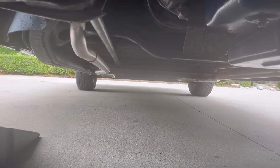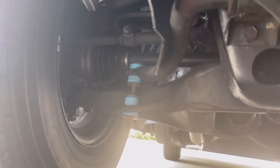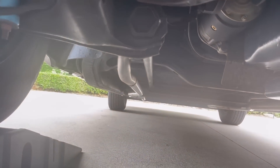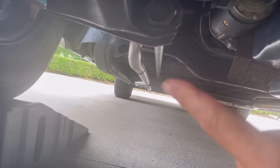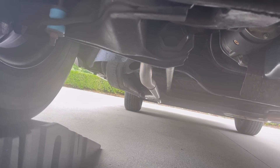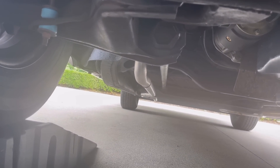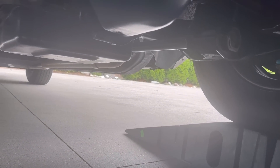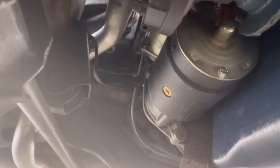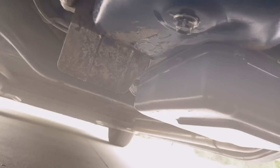Now we're under the car. You can see the front suspension on these — there are the half shafts that drive the front wheels. This is a front wheel drive car; you can see it has new stabilizer bushings. And then that's the torsion bar. There is no coil spring in there because they have to have clearance for the half shaft. It has a torsion bar that mounts back there into a rubber mount and this cross member, and that's what provides the resistance as opposed to a coil spring up front — true on both sides of this Eldorado. And then you have the starter here, old school GM starter. Look at the size of that half shaft — that is not a small half shaft.